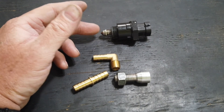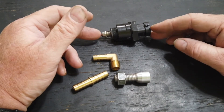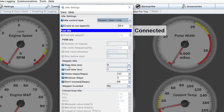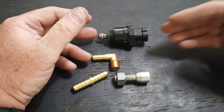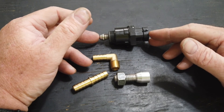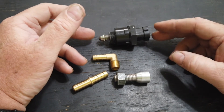The next settings I want to jump down to are for this particular valve. Step time — this valve requires three milliseconds to make a step. If we tried to send a pulse any shorter than that, it might skip a step. I've chosen to drive it at four milliseconds, just to give it a little more time to make sure we don't have any skipped steps. After that is cool-down time. Every time this valve makes a step, there needs to be a pause before the next step so that it knows to make the next step. With this particular valve, one millisecond is all that's needed between steps. You could set it to two or three just to ensure you don't have skipped steps, but the literature I've found says one millisecond is fine.